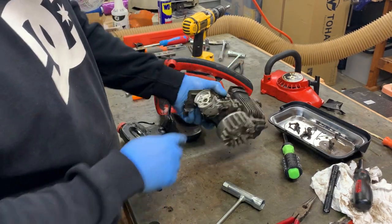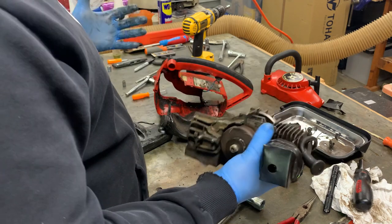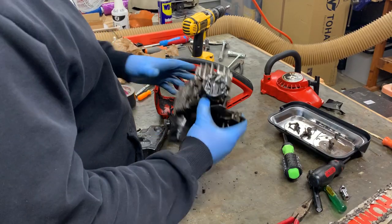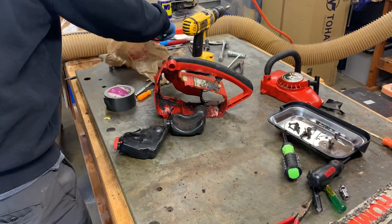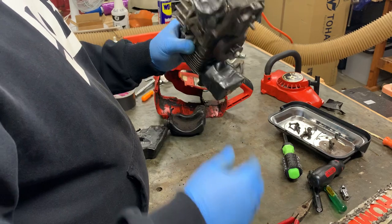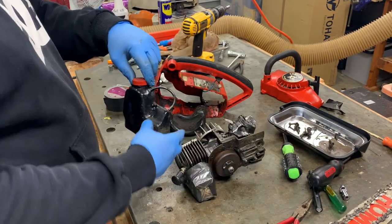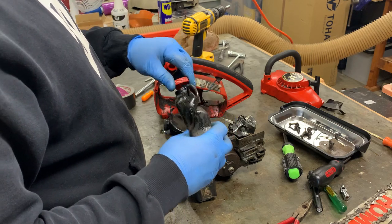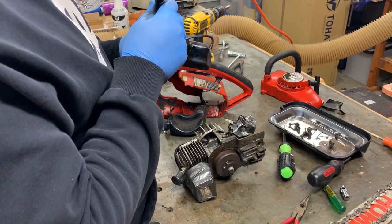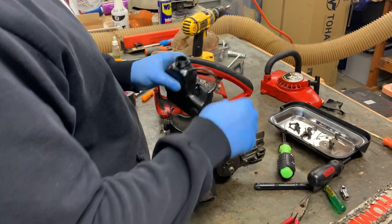I'm going to find a way to cover this up — probably a little bag and some tape around the carburetor — and get everything nice and washed down and cleaned up. I cut out a piece of battery bag and wrapped it around, duct taped it. It's not airtight or anything like that, but it's going to be fine. I'm not going to blast water inside there. Going to have to deal with the gas tank somehow — maybe put some fresh gas in it and keep shaking it around to break some of that stuff up, or maybe get a brush.